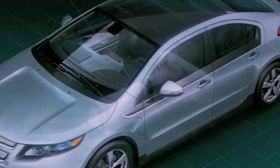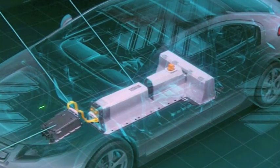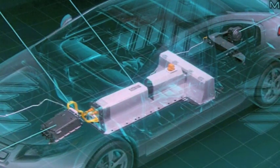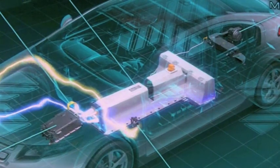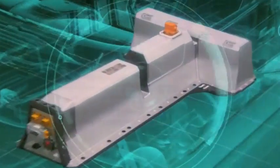Here's obviously the outline of the vehicle, showing the location of the battery in vehicle. The battery does form part of the body structure of the lower tray. High voltage connection to the drive electronics — the power inverter is the device that converts DC to three-phase AC to power the motors. APM takes high voltage DC and converts it to 12 volt DC to run the normal vehicle systems. The charge module converts AC line — which comes into the charge port at 120 or 240 volts — to high voltage DC for charging the battery. That charger is a global charger; it can work any voltage, any frequency around the world.